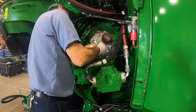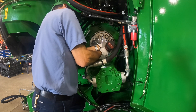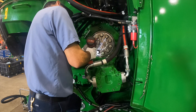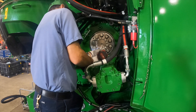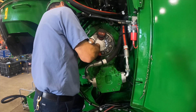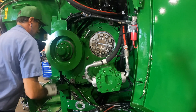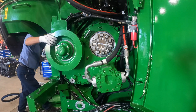Use the impact wrench to tighten the remaining bolts, moving in a star pattern until all bolts are properly tightened. Before finishing, double check timing. Visually inspect the chopper drums and blade engagement by rotating the flywheel. If all looks good, you're ready to torque.